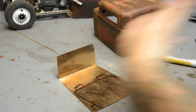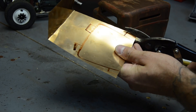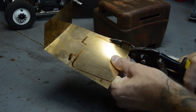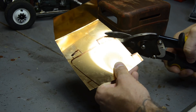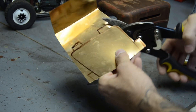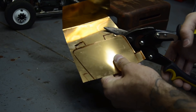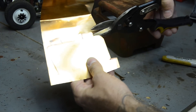Something like a diesel engine on the number two build — it doesn't house an electric motor so we have to put the transmission everything in the cab, so there's really no need to cut the firewall. We'll get the snips and cut this out. Since I marked this with a big fat Sharpie on the inside of the body, we're going to cut outside of our mark — I don't want to take too much off. We can come back and trim as needed. The tabs for the mount don't have to be perfectly shaped because they're not going to be seen at all.